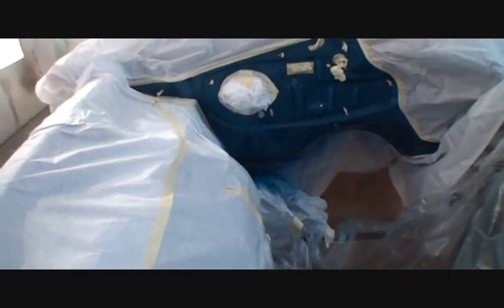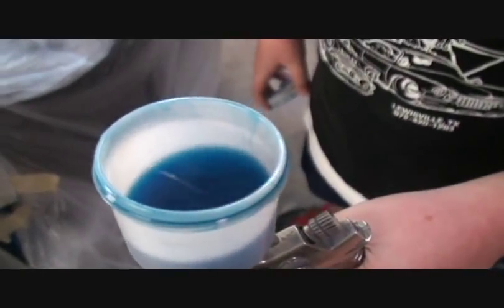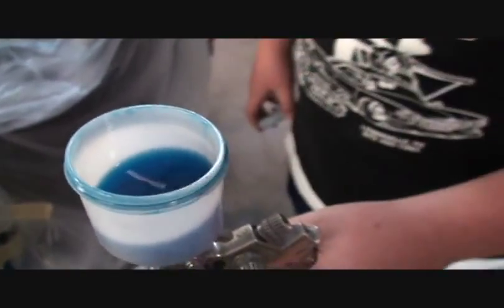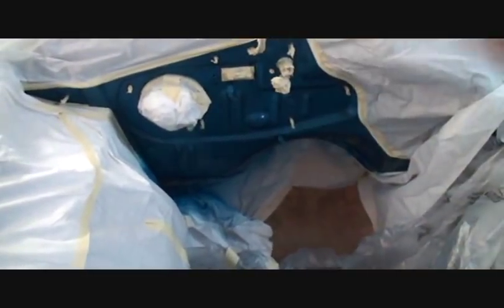See that our area has been painted blue, okay? It was right down in there. And also, we went ahead and took our reducer, if Trevor can open that up instead of playing with it. Open the top up easily so it doesn't splash. Hold it level now. There you go, take it off. One more time. Okay, and I left the residue of the paint in there, so I still had some blue paint mixed in with the residue. You get the idea. Put the lid back on it, Trevor. Tight. Okay. And what I did is I went ahead and sprayed the whole area that I blended into. Now once that dries, that will all blend itself in and you won't even know that it's painted.